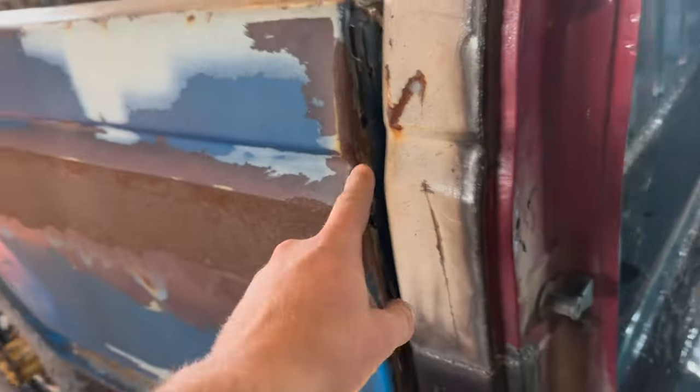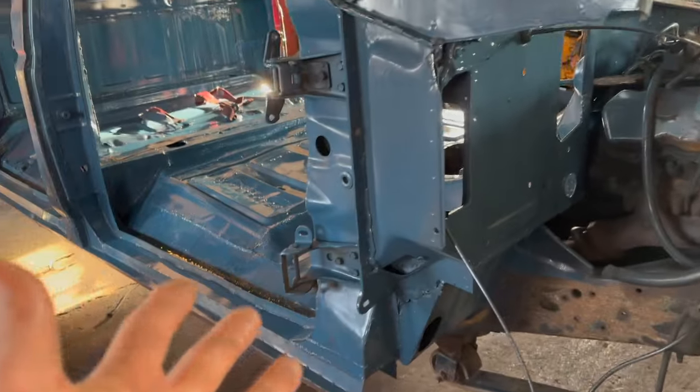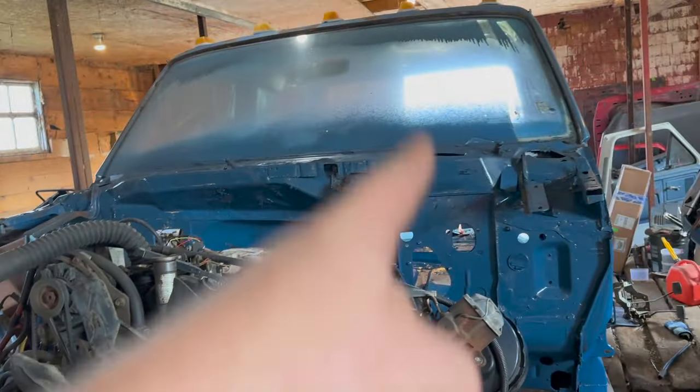Got that guy cut — he's no longer interfering. We got the body mounts, all four, all set up. We'll hold off on the bed just a little bit — I'm going to have to lift the bed just a touch around the entire truck. That will get those mounts all squared up. Now what we're going to do is paint this frame black. I got to grind and paint, especially down where my welds are. We'll get that guy painted while he's easy to get to, and then we should be ready to start reassembling the front end.